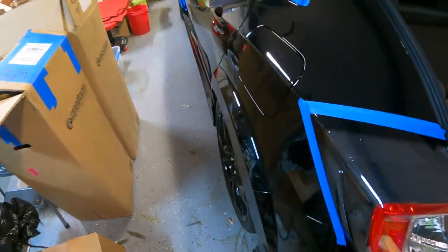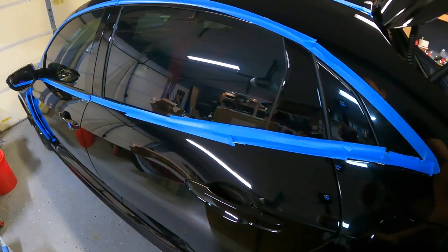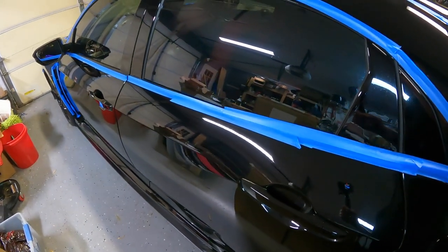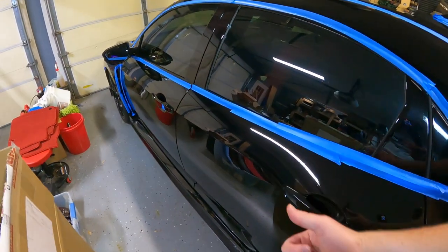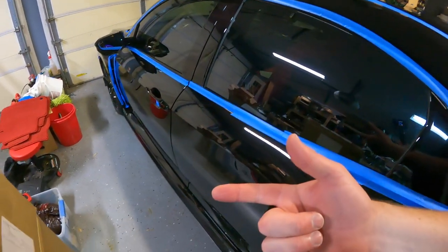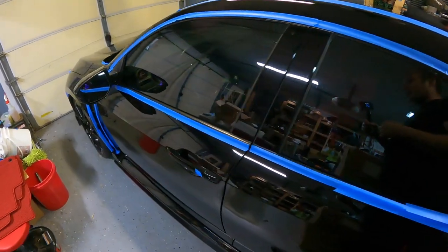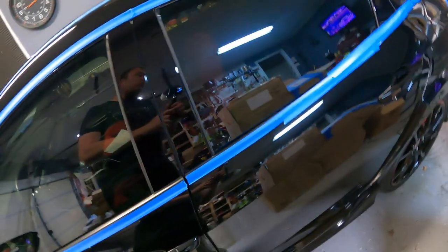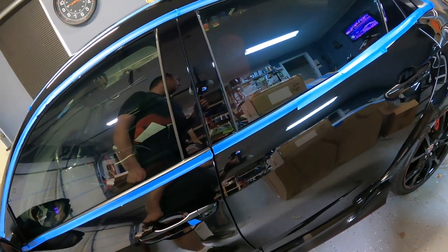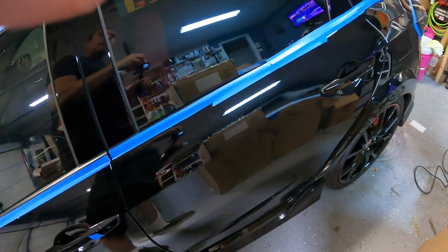I tried to use 3D eraser all over this to get rid of the water spots, and it did help tremendously, but it didn't take 100% of them off. So the conclusion I'm coming to is that the best way to get them off is to use a very light polish. If you're chasing water spots, I suggest going through the steps of vinegar, wash, use an iron remover like Americana Global Release to try to lift stuff off your paint before you go to machining. Don't just jump right to machining — if you can get it off without it, your coat will last longer.